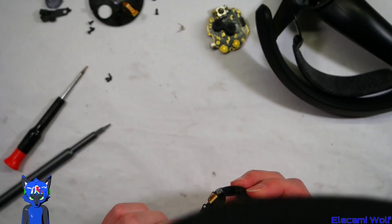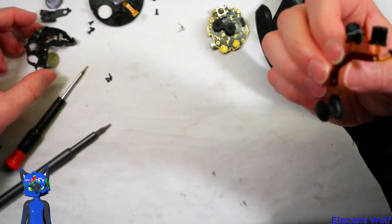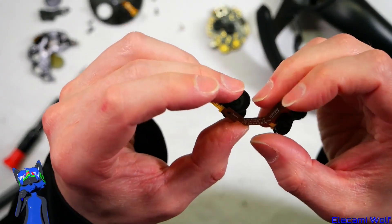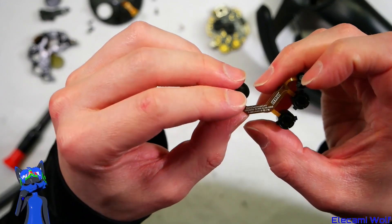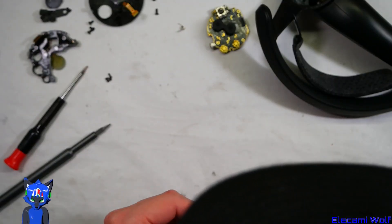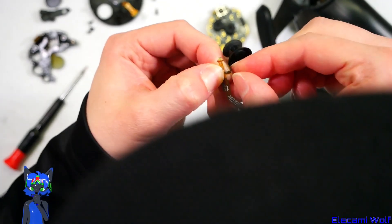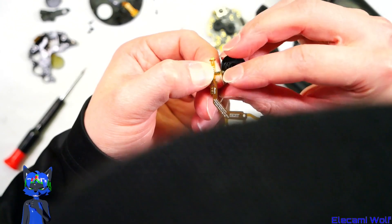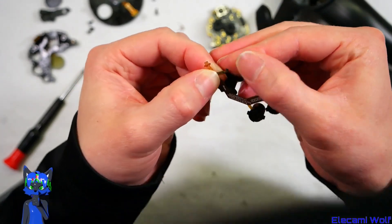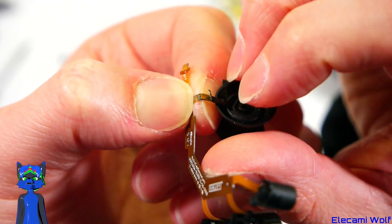I don't know if I can pull all this stuff out to make it easier to work on — it looks like you can. So that's the touch board assembly — it's got tape on it holding it down. It says 'multi-cap sense left' on it. There's tape on both sides of this which is supposed to let it bend without breaking. I'm going to peel that off and see if I can see where it's broken. Yes, the flex board is snapped right there — that's the reason why it doesn't work.